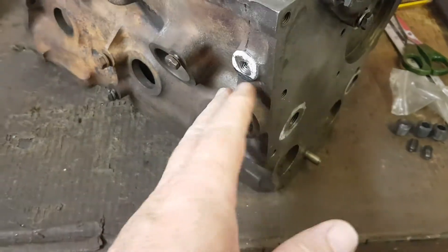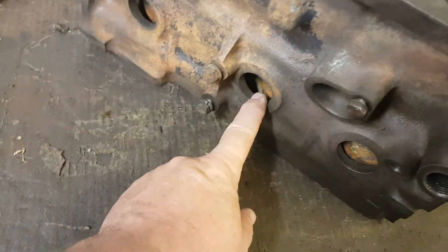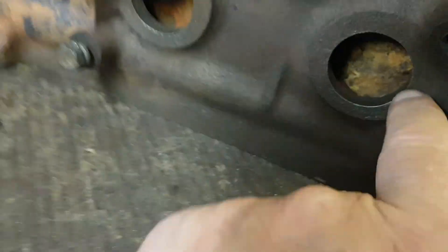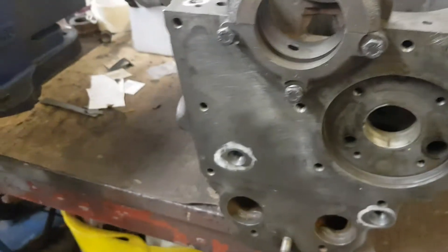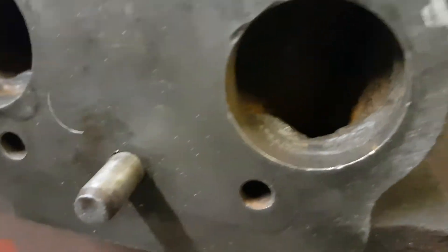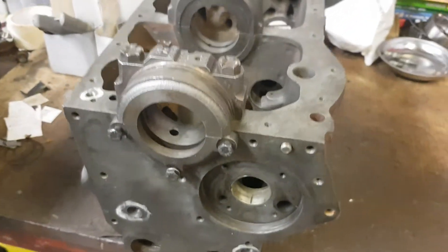This is all going to be cleaned out anyway. I've got quite a lot of work to do cleaning this out. I'm going to seal it, put a sump on it, turn it upside down, put some Welsh plugs in, fill it with some water and caustic soda — and all this oxidisation on the inside here will hopefully go and leave me with some clean metal. It's ready to be cleaned out. It is a bit rusty but it will clean up.